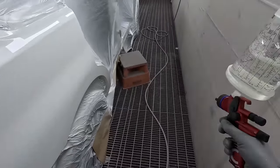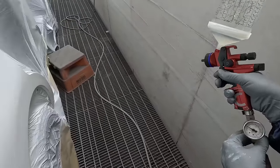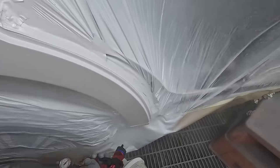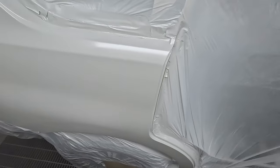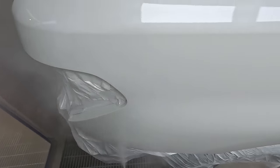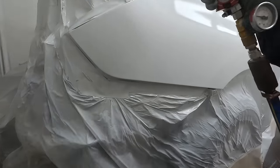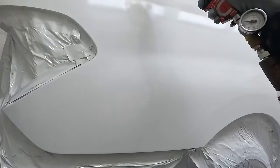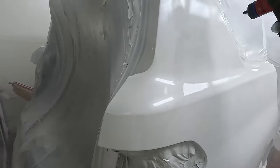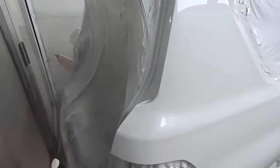That's my first coat, and I don't want to leave it too long. I've been going back to the way I used to spray — put your first thin coat on, and the only time you're waiting is the time it takes to get around the job. I'm not setting a timer for five minutes between coats. Even now I can see this second coat — I have got a little bit of flash between first and second, because I went so skinny on that first coat. Now I'm turning that pressure down to about 30 PSI or 2 bar, getting a little bit more material on. Because the first coat was so skinny I've got a nice thin layer underneath, so I'm not going to have excessive orange peel.